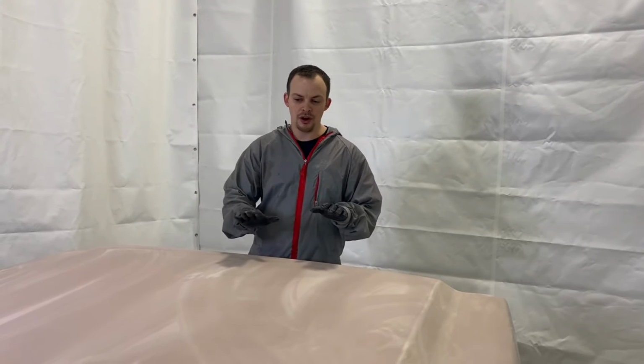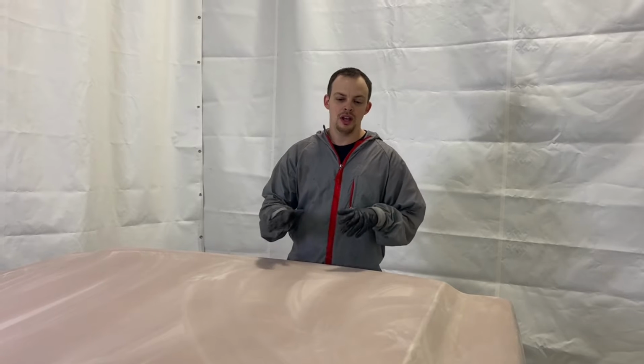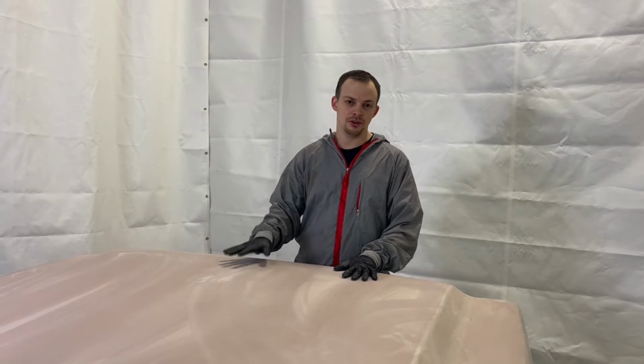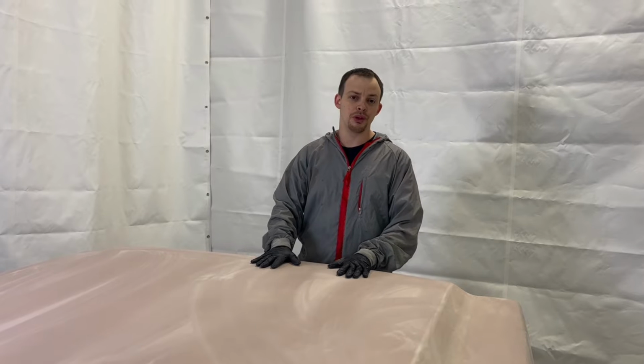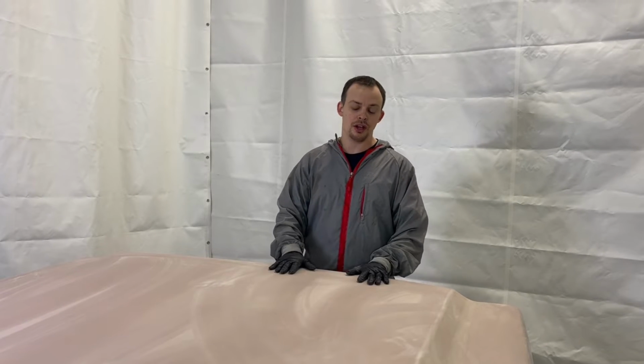All right guys, we've already got this hood primed. We've put 3 good coats of Roberlo Repox on this. Instead of going straight to sealer, we use this epoxy because we sanded this hood to bare steel in a lot of places, so we wanted to get some good corrosion protection back. We've sanded the whole thing, the epoxy, with 320 grit, and now we're ready to wipe it back off and get ready to seal and paint this hood.